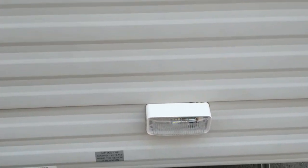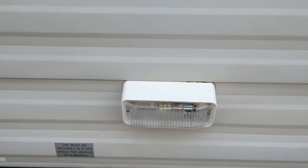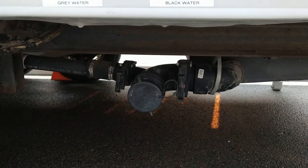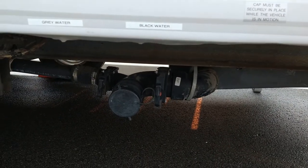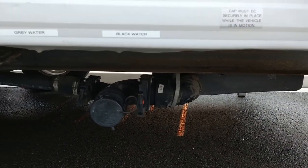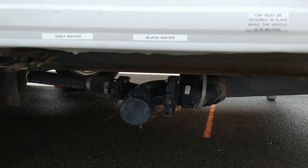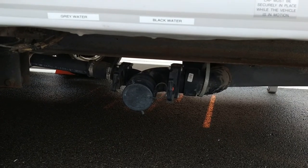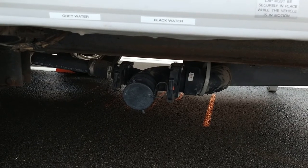Here's your exhaust for the furnace to heat the inside of the camper. Here's a utility light — obviously useful if you need to dump your tanks in the dark. I upgraded all three exterior lights with LED bulbs and new housings. Here are your dump valves: the small one is your gray water, the big one is your black tank. Keep your gray valve closed, open the black valve and dump it all the way out, close it, then dump your gray water — it'll rinse your hose out.